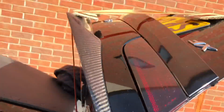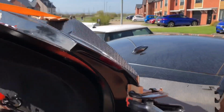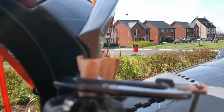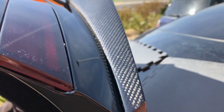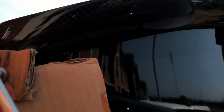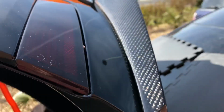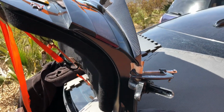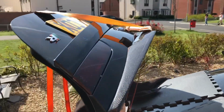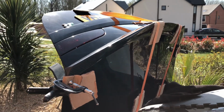So Tiger Seal, I was looking at the data sheet. It takes 24 hours to set totally on a thickness of 1/4 inch. But this is obviously a lot thinner, so it shouldn't take 24 hours. I'm going to leave it on there as long as I can, just to make sure, because I know this stuff has got to grab. So I'll leave it on there until tonight.